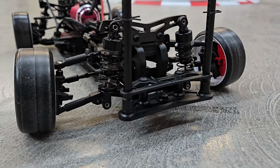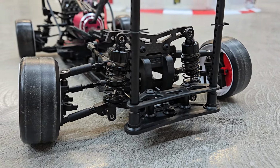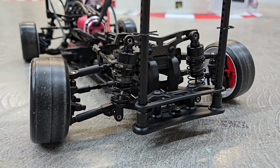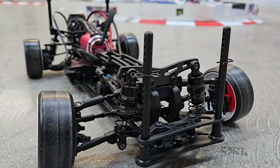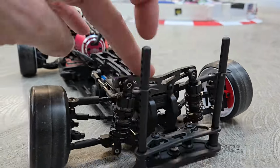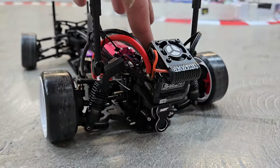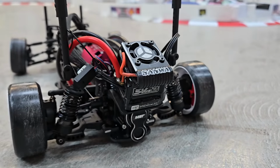So that's resulting in high angle and lots of drivability. My preload setting, along with the factory 3mm adjustable heights here. This is 2.5, and in the rear it's 2. No, sorry, this is 2 mil. The rear is 2.5. So that's what that is for the adjustable top hat. That's what they specified in the manual. And my preload setting of, I think, 2.5mm preload on here and 4mm in the rear. Lots of damping in the front. Lots of damping in the rear. Although it's a little bit stiffer just at the moment because of the way the shock's orientated.